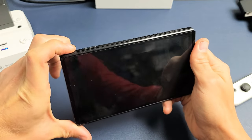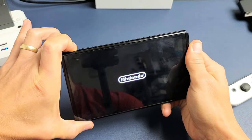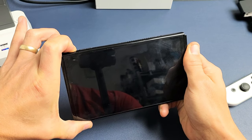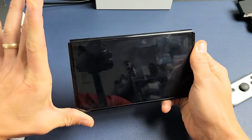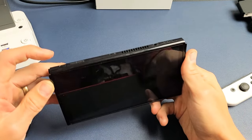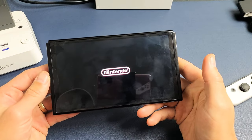Here's the power button. Press and hold it — one, two, three... all the way to fifteen seconds. Then go ahead and let go. Now go ahead and tap the power button once, just like that, and see if it boots up.